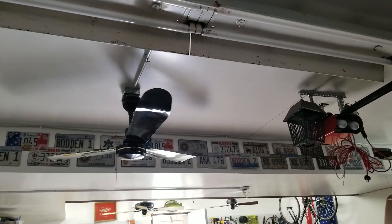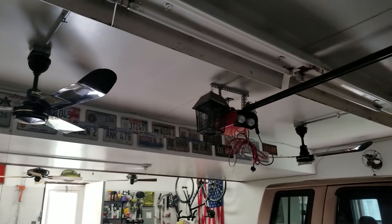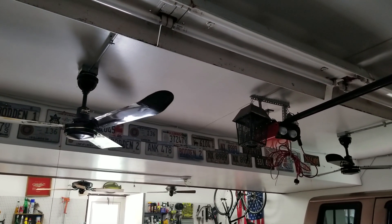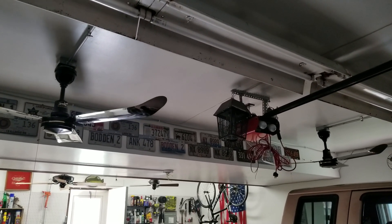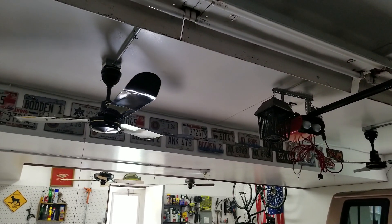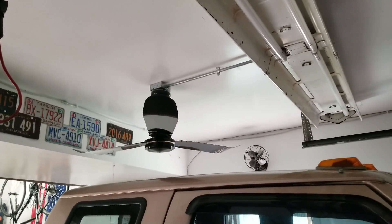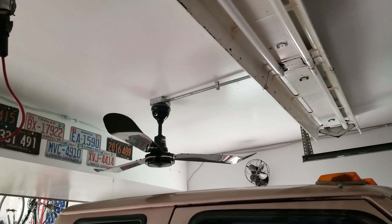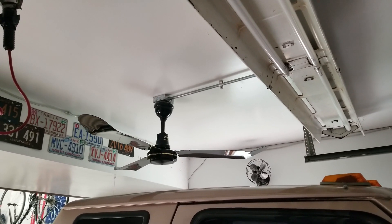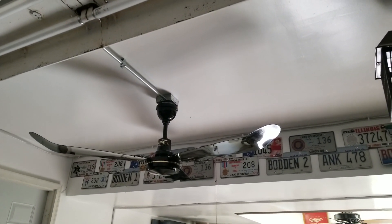I also painted the inside of the motors — I think I did that on the ring fans too — just to prevent rust from spreading if there's any left behind. I think I did a pretty good job removing all of it, but unfortunately with these I couldn't get the stator out; I think they pressed it in. Much smoother-running fans now. I'm very happy with the results — these are like brand new condition. This next one is from April 2015. Alright, hope you guys enjoyed, and thanks for watching.